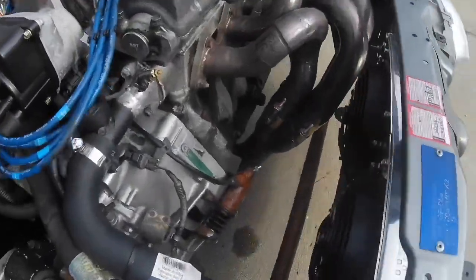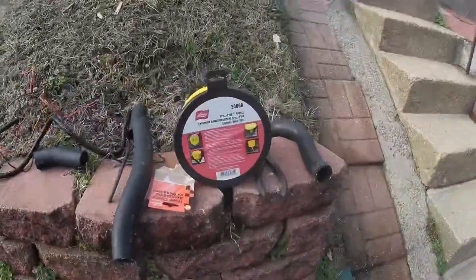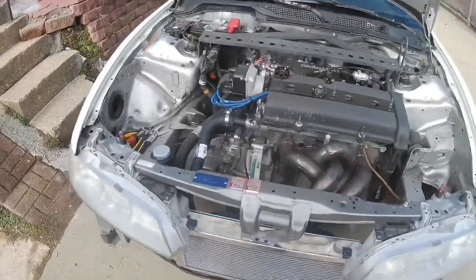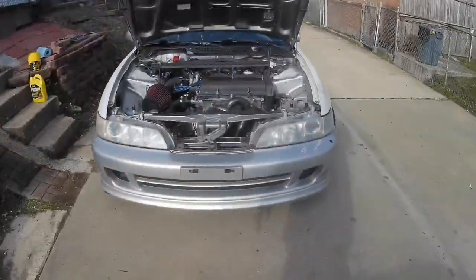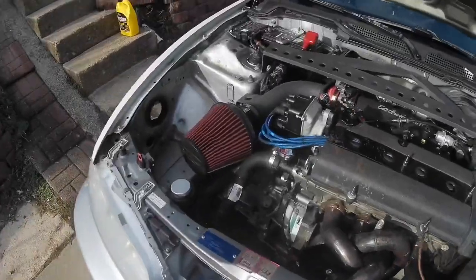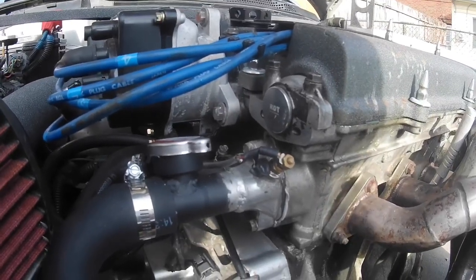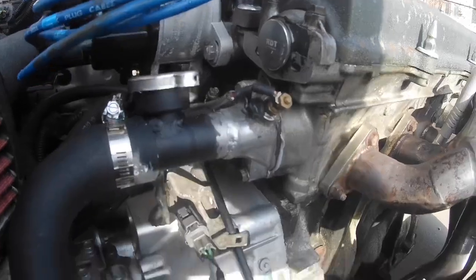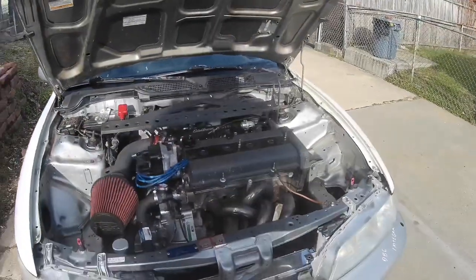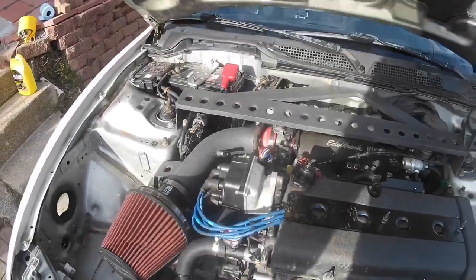The only thing I still need to do is get that little bracket welded, but right now I'm going to hook up the spill-free funnel and bleed the coolant. Everything's all put together, no leaks, the system has bled. I'm pretty happy with the filler neck — my friend did a pretty awesome job. It does sit a little sideways but that's probably just from how I marked it. Eventually if I decide to stay LS I'll get a track-tough one that curves up and sits higher so you don't need a funnel to bleed it.